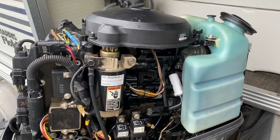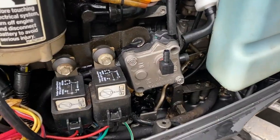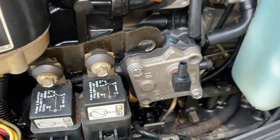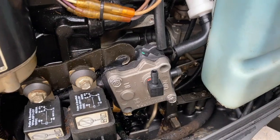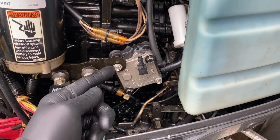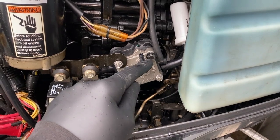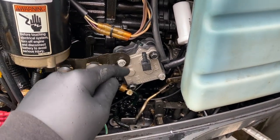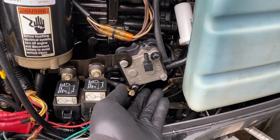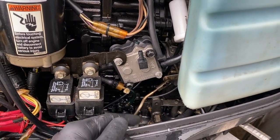Back to the lake and the outboard — it's starting to sprinkle. We are going to reverse the steps and secure the brand new fuel pump. The first thing I did was secure the hose, which is the trickier of the three hose connections, so I did that first. We had to loosen up a bolt because of the brace or mount, and we've inserted both of the bolts that will secure the pump to the engine. Using all 10 fingers from the back side to properly place and position that gasket.